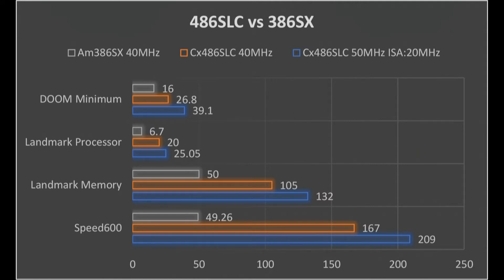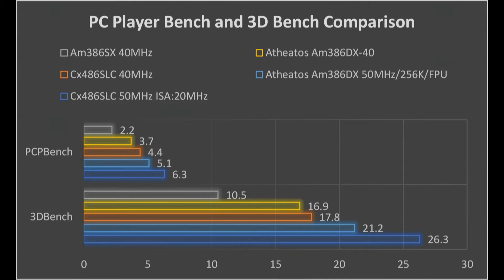Not everything even sees this gain. PC Player, for example, doesn't change at all. This mostly has to do with how many frames have to move through the ISA bus — PC Player is a low frame rate, so less data moves to the video card. 3DBench gets higher frame rates and therefore spends more time doing ISA transfers — Amdahl's law in action. This also coincides with findings on the CPU Galaxy Channel, where installing a 386DX in a VESA local bus motherboard drastically increases bandwidth to expansion cards, but benchmark performance hardly changes because the CPU is, and always has been, the bigger bottleneck.